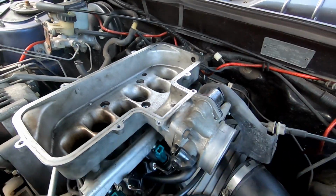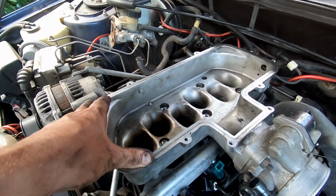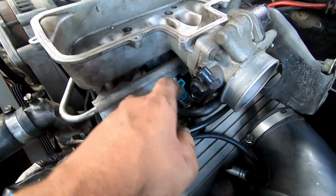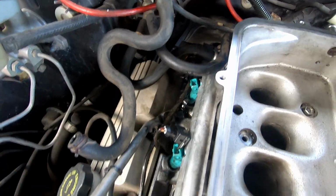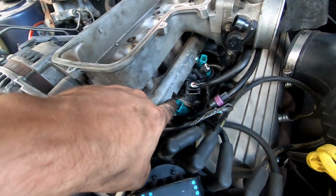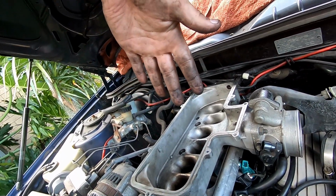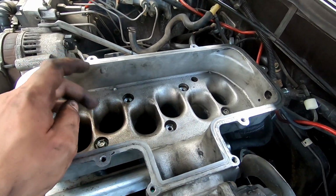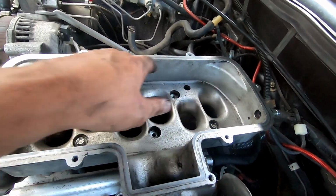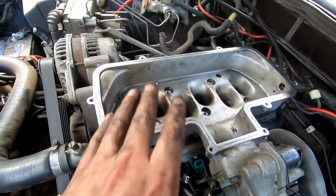So if you put the plenum back on, line all them up and start tightening it down, it brings the injectors into place and seats them nicely after we found out trying to mess around with it. But they're all in, all those little C-clips are back on because we yanked the plenum up and clipped them on. Yeah, now it's time to tighten down these 5 bolts. Obviously in the not a star pattern, but outside and inside.